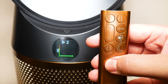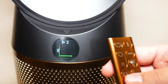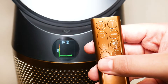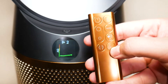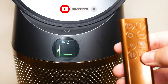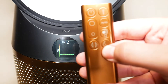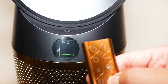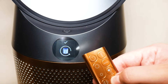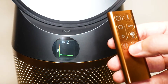Once you've installed both filters — the carbon and the HEPA on both sides — everything is clicked in. Now you need to reset the HEPA filter. On old models you used to have to reset the carbon and HEPA filter separately, but what's different about this new model is you just hold down the half moon button to reset the HEPA filter, and that works for both — at least that's what Dyson told me. Just hold down the half moon button and a countdown from five will start. Once that's finished you'll get a check and it's done.